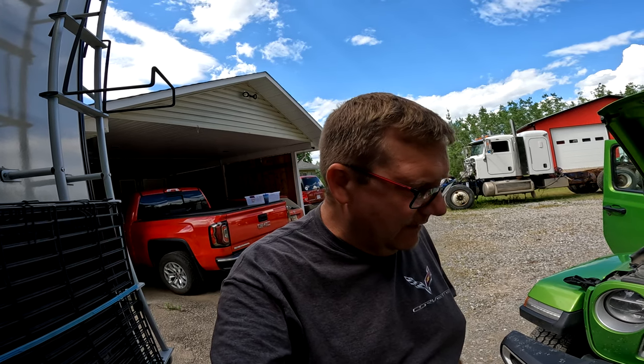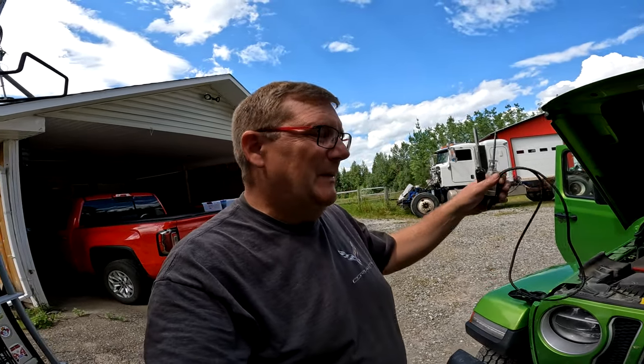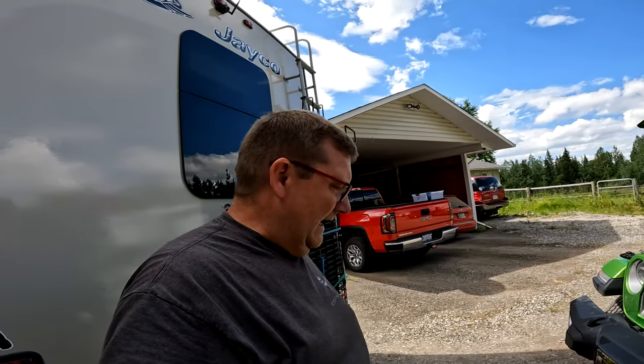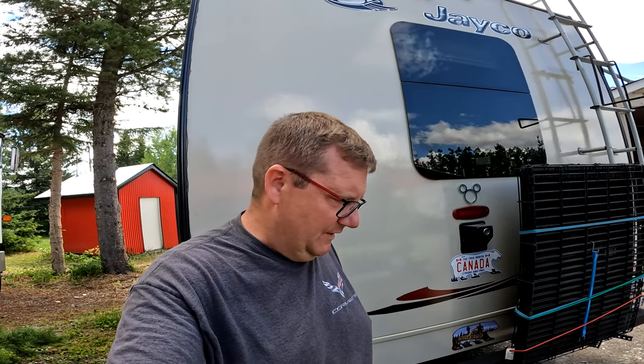Now I'm gonna hook up the breakaway switch because, you know, you don't wanna lose a $50,000 Jeep, which, let's be real, right now it's probably a $60,000 Jeep with the way prices are. And that way, heaven forbid, if something happens and it comes detached from the motorhome, it can put the brakes on, come to a stop wherever it is, and be safer, because the last thing you'd want is for it to come unhooked and go into oncoming traffic and possibly injure or kill someone. So that's a reason for the breakaway switch.